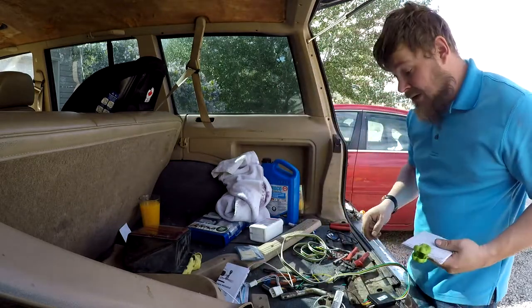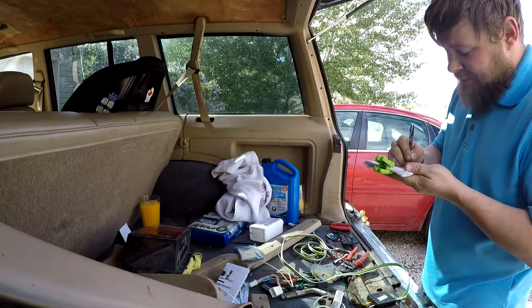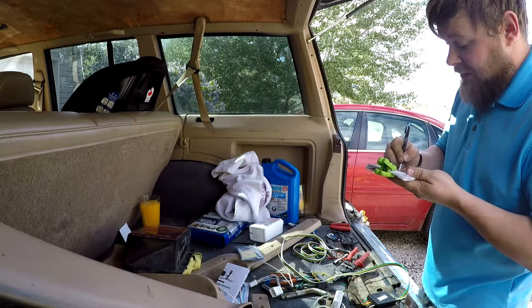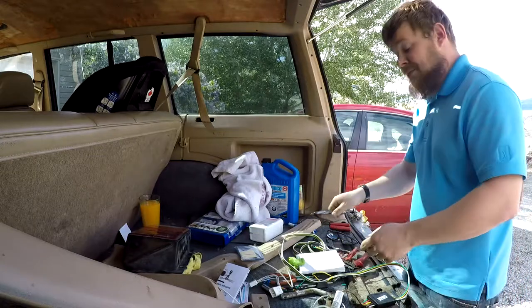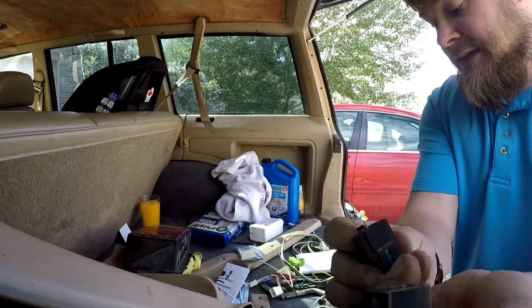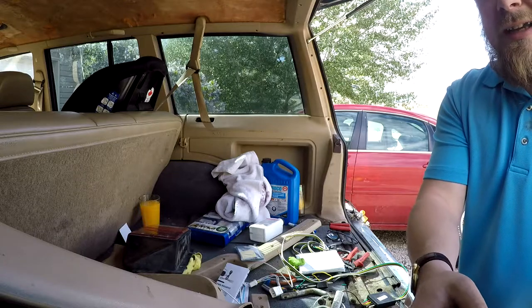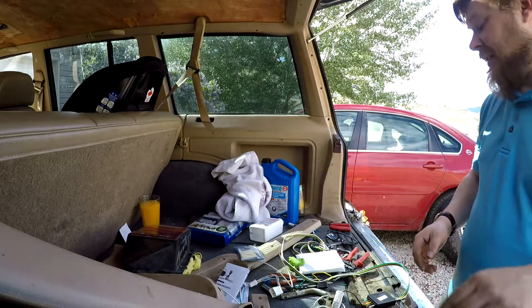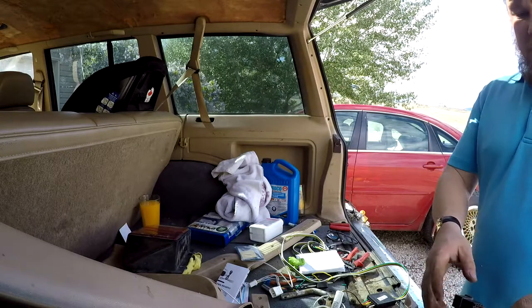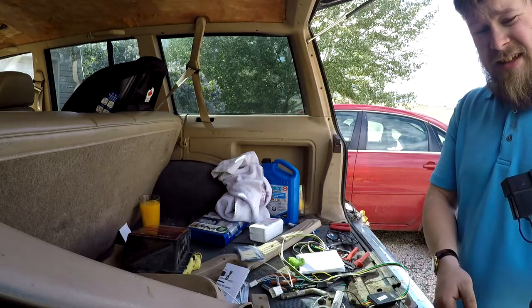All right, so we're gonna write this down just in case. So one white, right turn signal. So these harnesses, I'm not gonna cut them. I decided that. I doubt you can see these things from the camera angle, but I'm not gonna cut them. I'm gonna put them back together. I'm just gonna thread into the signal and leave the signal there and just piggyback off this wire here, this longer one. I'm not gonna tie into the car harness. I'd rather replace this little cheap harness. I think these are like 20 bucks on Rock Auto.